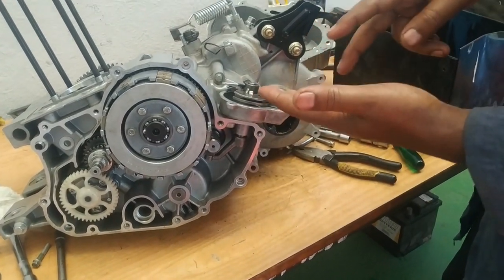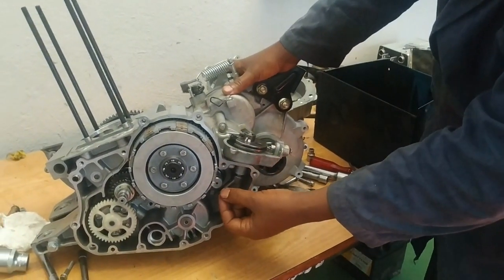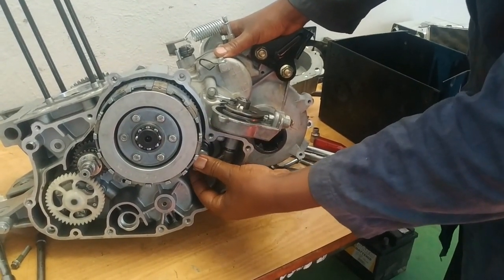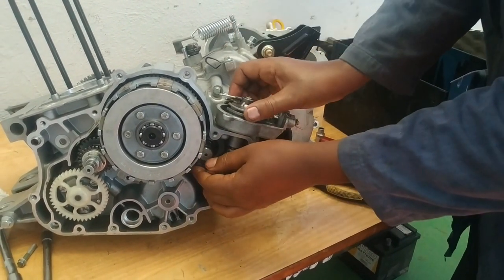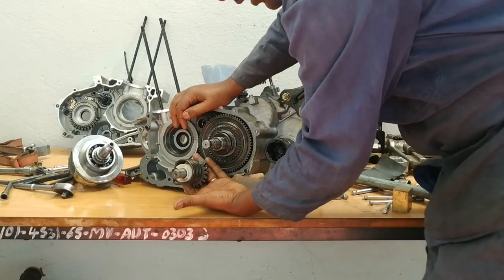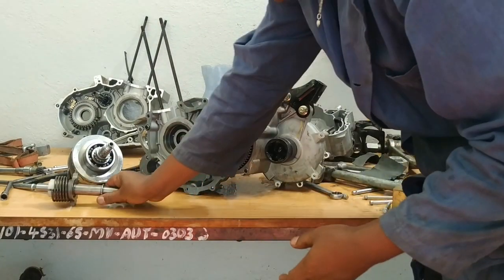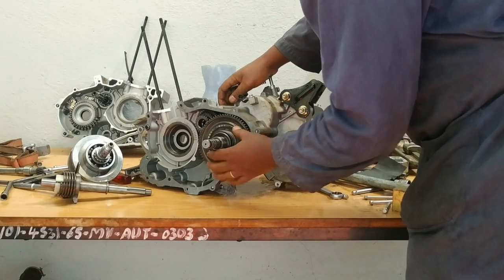When this is moving in the horizontal direction, it will bring the star that connects the shaft to the speed gears to the consecutive gears — first gear, then further to second, and so on. So this is how gear is selected. The gear selection mechanism is activated by a cable.